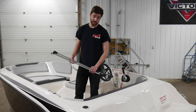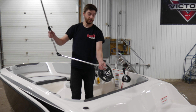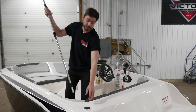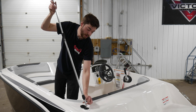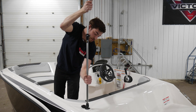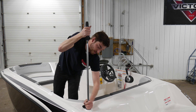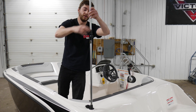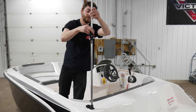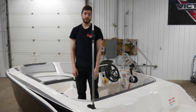This right here is your stern light. It's stored in the bow. It's foldable. It has a screw on it. What you're going to do is put it in this slot here. It goes in one way. Push down until it's seated and then turn this plastic thread insert until it's tight. Since it is foldable, you'll fold it up right and do the same thing up here, and then once it's tight, your stern light is in and you're good to go.